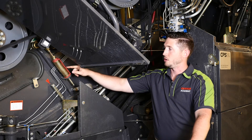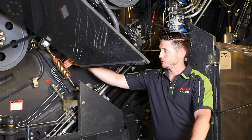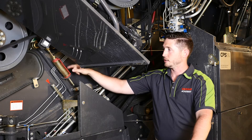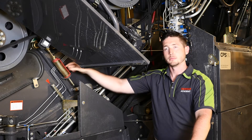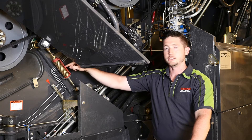Here we have what we call a tip-to-tip type of tensioner. We have our spring tensioner for the belt and we have our red indicators joining at the tips of the indicators. This will give the spring tension the proper tension when these are tip-to-tip.